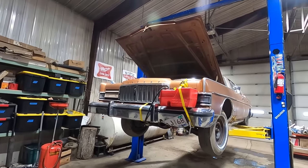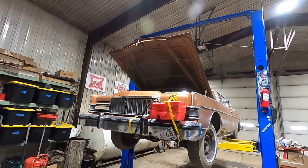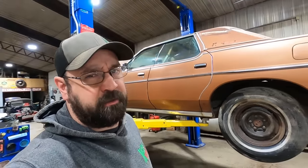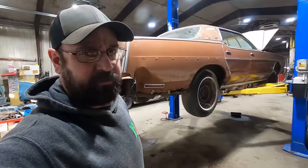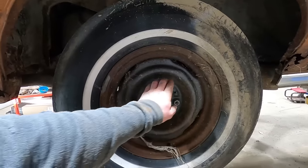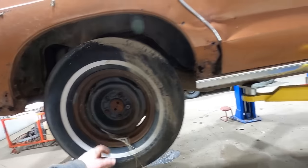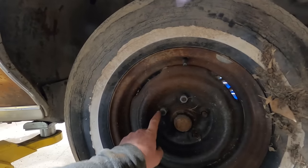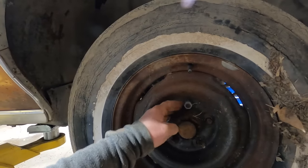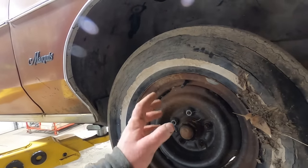All right, I think we're ready to test the brakes out on this thing. Hopefully the hood closes with my fuel tank latch, but if we have to address that, I'm sure we can find somewhere to hook that thing. We don't need a hood latch anyway. I was just setting this thing on the ground and looking at the lug nuts, or lack thereof. We should probably address that if we're going to be doing some burnouts and high-speed runs. Three missing I can deal with, but you can't have two in a row that are missing, so we'll pop that guy off and put it there or there. Either way, that should be good. And on the front, two is an absolute no-no. But if you're gonna have two, at least space them across from each other. Don't put them right next to each other. So I think we're gonna grab a couple more and put on that wheel. I'm definitely not worried about that tire, but we don't want the whole thing coming off.